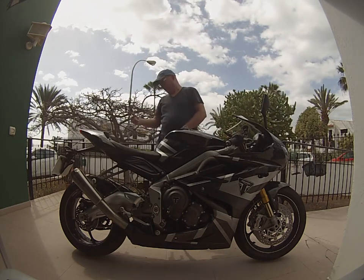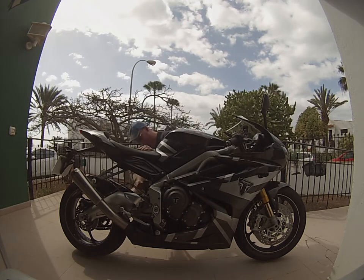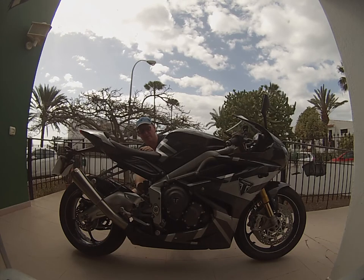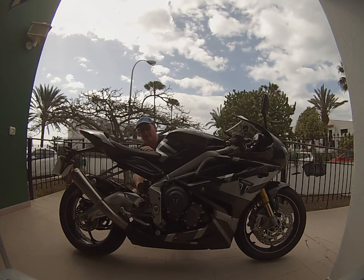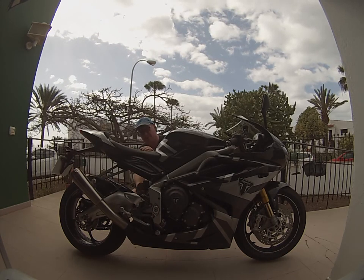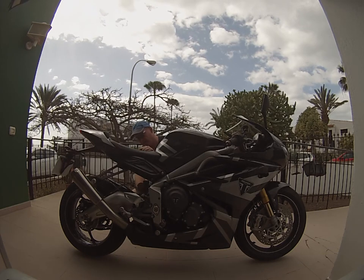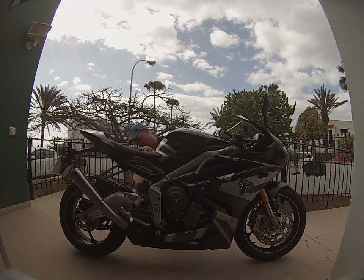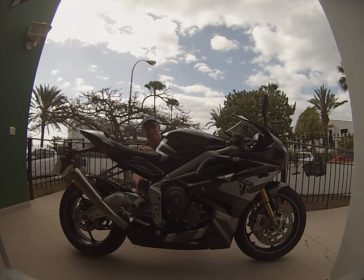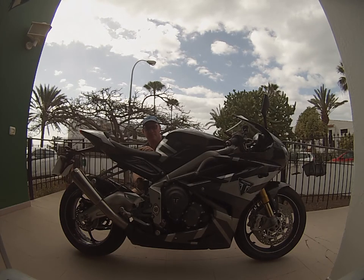I'm just going to do the clicks on the back, which is just little wheels, which before I sign off the video, I'll just have one more walk around the bike so you can have a look at it. So, push me up. So this is rebound first. 1, 2, 3, up to 20. It says 20. So I'll just wind it back. Same with the compression, that's the gold knob at the top. Up to 20, 20 again. So I'll just wind it back.